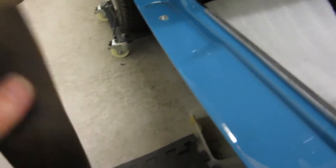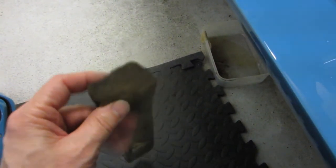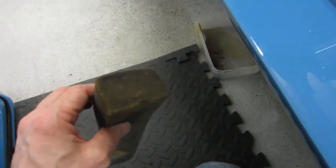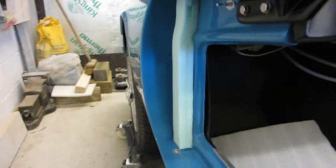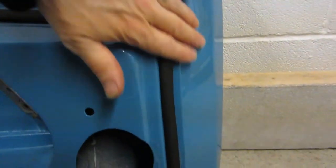So you end up with the fiberglass just pushing up against the fiberglass. The idea is these are trapped between the door and the body and will get squashed as the door opens, just giving it a bit of buffering. These ones are the originals. I think the foam is probably much weaker than it would have been when new, so I'm going to make them out of some new foam and glue them in place. This is the area on the door it's going to push up against.